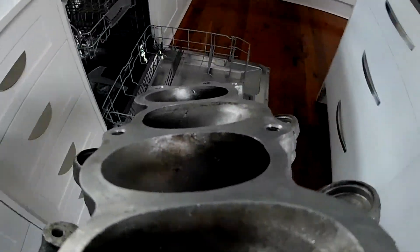Lower inlet manifold - it's all just been clean-up work, just getting rid of all of the casting flash and casting irregularities. I haven't opened any of the ports up or done any gasket matching - I'll probably do that later at some point. At the moment I'm just trying to give myself a bit of a head start on things, so that when the time comes I'm not snowed under with heaps of manual labour. So it's a good start anyway.